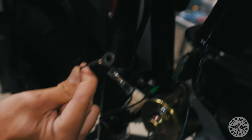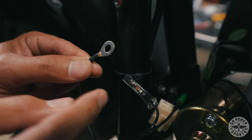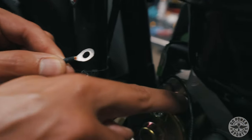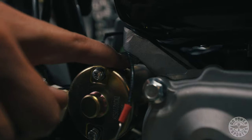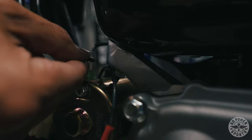What's left is the ground wire coming off of your Megamoto 212's wire harness. We're going to open up this ring terminal, undo the nut on the bottom side of the engine's gas tank cast, put it underneath the nut, and tighten it back up.